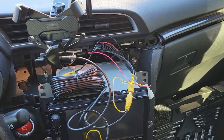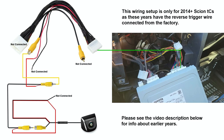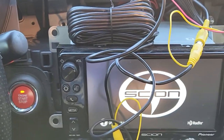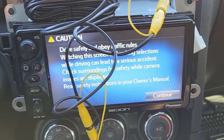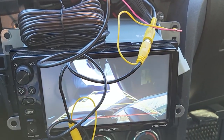I have the video extension cable plugged in between the harness and the camera. The extension power wire, which is yellow in this case, is connected to the red wire on the camera harness, and it's going to be the same setup on the other end with the yellow wire connected to the red power wire going to the camera. You may have noticed that I don't have the black ground wires on either end hooked up. This wiring method works on 2014 to 2016 TC since there's an OEM camera connection on the radio and the reverse trigger wire is already connected from the factory. I'll have more info for earlier TC owners in the video description below.